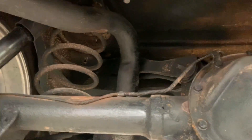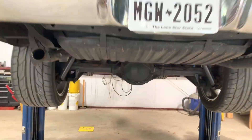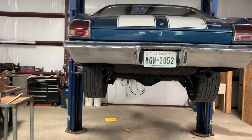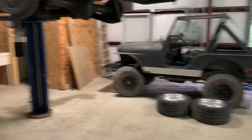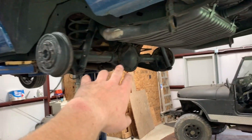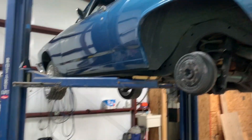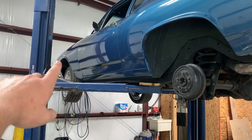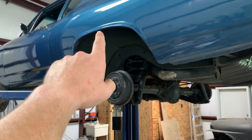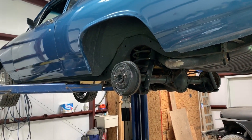I try to do a little follow-along because I try to do walkthroughs of things that don't previously exist, and this one did not previously exist. So stay tuned. I've got the wheels removed and I've gone around and hit all the components with PB Blaster and let that sit. I went ahead before I lifted the car and measured the height of the front and the rear. We were at 28 inches in the front, both sides, and 24 and a quarter and 24 and a half on the other side - it was always sagging on one side a little bit.